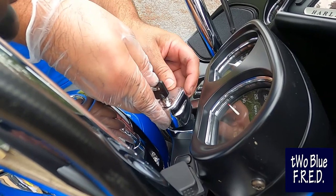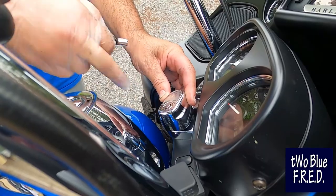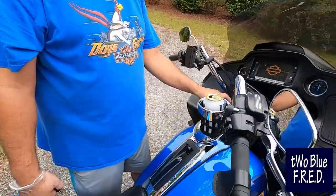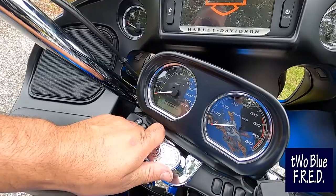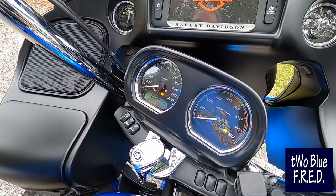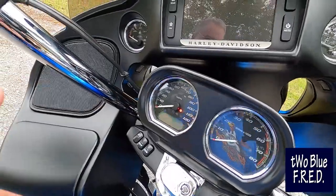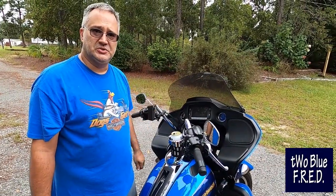You're going to get a little bit of spring tension as you get down in there, and then you just move it back to the unlock position on the key. And all of your positions — you can just go through all of your different positions from accessories, back to ignition, back to off, and back to fork lock. And as long as all four of those positions work, congratulations, you did it right.